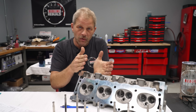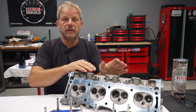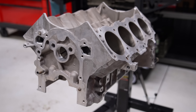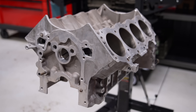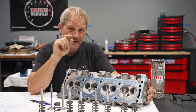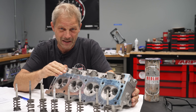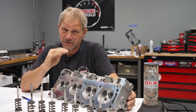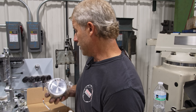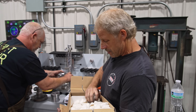That will be great when we go to put a performance camshaft in there — it'll all work together to get us our increase in horsepower. Now on our block side of things, that is ready for the higher compression pistons, but we still need to address the rotating assembly because 60 grams — like I mentioned in the last episode — is not acceptable in anybody's world. That'll rattle your britches right off going down the street at higher RPMs. So we're going to head down to Allshaft Repair and Doug's going to help us get the rotating assembly closer to one gram.